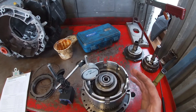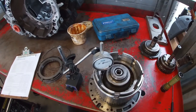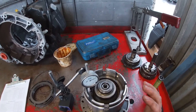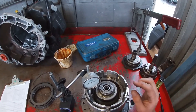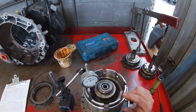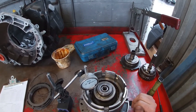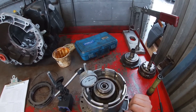Now what we're going to do is actually measure the clutch pack clearance for the input drum. The way we're going to do that is the most accurate way the factory calls for — measuring it dynamically in the drum itself. The difference between taking the clutch pack out and measuring it with vernier calipers versus measuring it this way is that we're able to check the entire circuit, how it sits in the drum, how it reacts to the reaction plate, and get a feel for the actual clutch clearance.